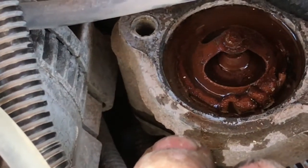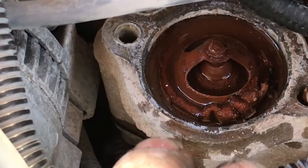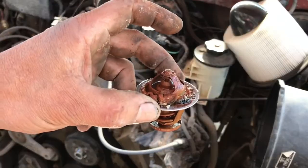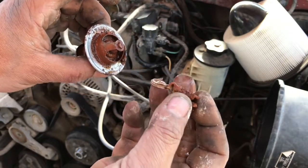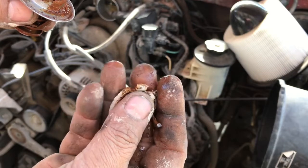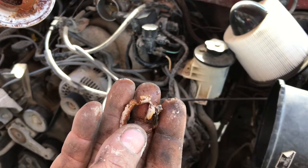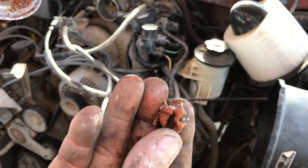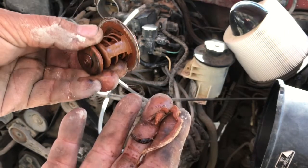That's not normal. I can't tell what it is — I don't know if it's just a whole bunch of crud, silicone or what. Let me remove that and inspect it closer. Silicone — that's another thing you don't want to do. All this junk goes to your radiator, gets clogged up in those little pores, and your radiator is not going to perform the way it's supposed to. You're closing off cells, less coolant gets cooled down, so overheating starts to happen. I'm going to take that radiator apart and show you what those radiator cores look like on the inside. But we're replacing this one.